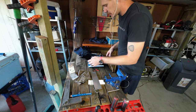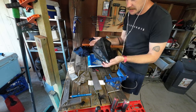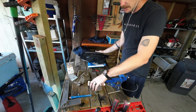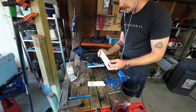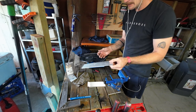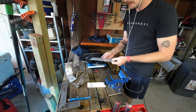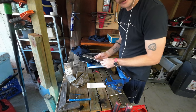Now the core of the rally screen itself is quite simple. We have a windscreen — this is off a Kawasaki Z800, I think about a 2013 model, I'll put a link in the description — and just some fluted three mil alley that I picked up from my local hardware store. This stuff retails for like 20 bucks a length for about a meter. You could do the whole thing with a meter; I used about three meters because I've made many alterations, picking up more every time I make a new version. It's nice and easy to do, so why not give it a go?